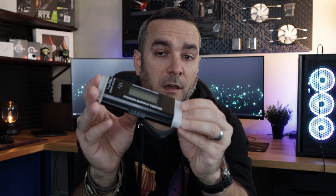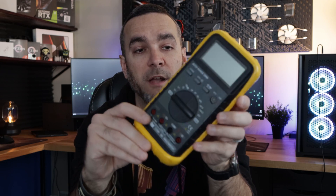One of the easiest ways to test your power supply is to use some type of power supply tester that comes with the power supply — it comes with a lot of power supplies today and has a built-in jumper already in the block. You can also buy power supply testers off of Amazon — I'll link this exact one in the description — and it will give you a digital reading of all the voltages coming off each of the power rails. Last but not least, I'll show you how to test your power supply using a multimeter.